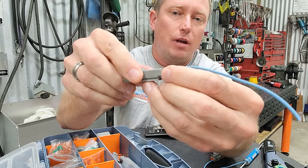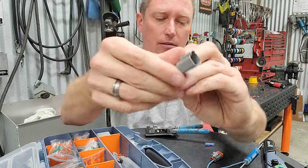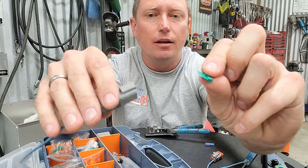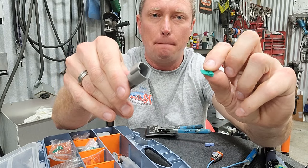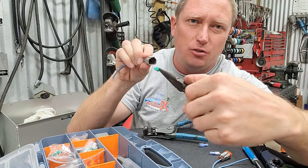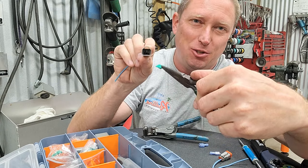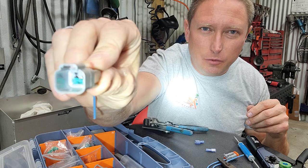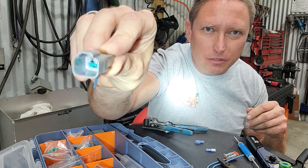I find I have my best success when I push it in up close to the terminal — you'll hear it kind of go in and lock in. Can you see up inside of there? There's our little male terminal in there. And then at that point you're going to take that little wedge and insert it right down inside of there. I recommend using some small needle nose pliers for that. With my little green wedge, basically what you're going to do is insert that right up in there so that it goes and locks in place. You can see that little green wedge right up inside there — it basically holds those little terminals firmly in place.